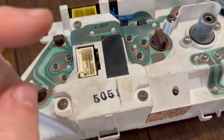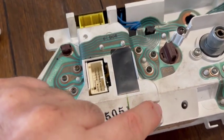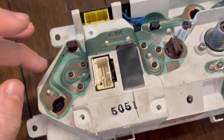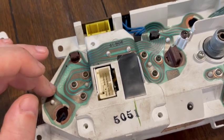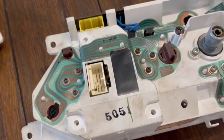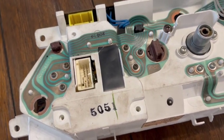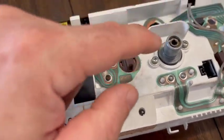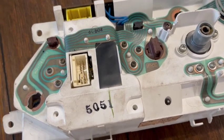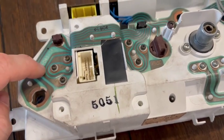Because I need both hands, I'm going to now remove these three screws. Okay, so I just got done removing these three screws. The reason why we need this loose is because we need that piece to be movable in order to get the gauges out — there's a piece of plastic that hooks around and goes behind the speedometer, which is used for lighting up the gauges at night. In order to get that in and out, we need it movable. If you're having difficulty, you can remove the speedometer and then slide the whole thing in, but this way you don't have to. I just want to step through how to do it to help out whoever this may help.